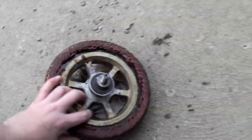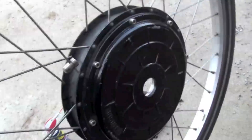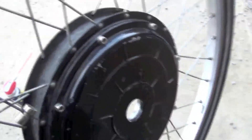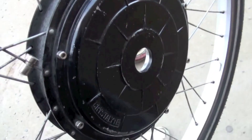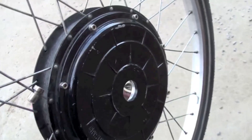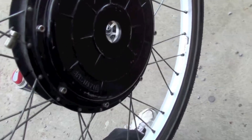When you're putting it back in, the best way to do it is to put the motor like this, get it balanced so that it's straight, and make sure it's not going to wiggle. Then slowly lower this down over the axle. What will happen is the motor will actually be sucked up into the enclosure by the magnetism, and then you just reassemble it.